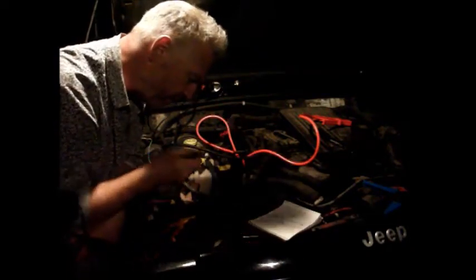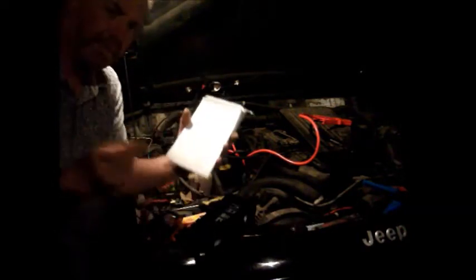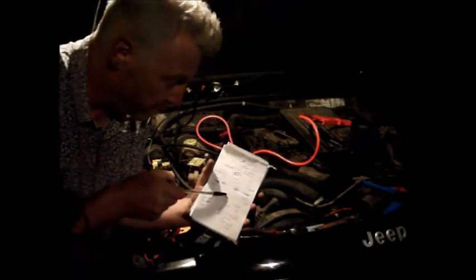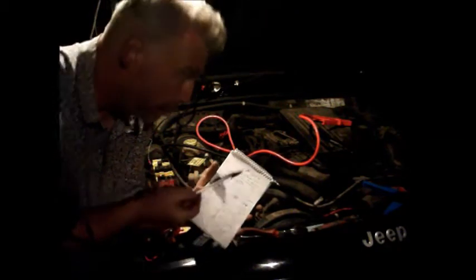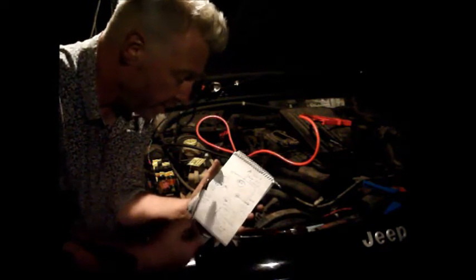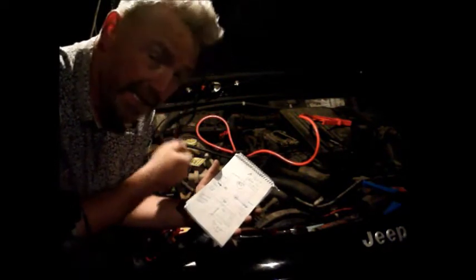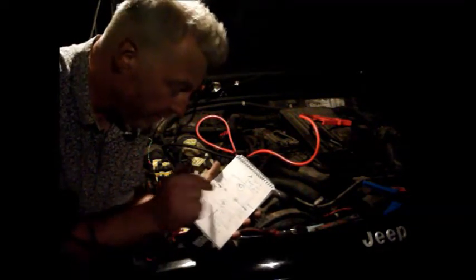So instead what I've done is look at the wiring, and you can see it here, of the fuel pump relay. On terminal 30 you've got a constant live from a 30 amp fuse coming in, and then terminal 87 takes the power back out to the fuel pump at the back of the car, but the relay itself is switched through terminal 86. That's the switched 12 volt coming in, and I've tested that and it is still there. So that's on the ignition switch, that comes live and goes off with the switch.